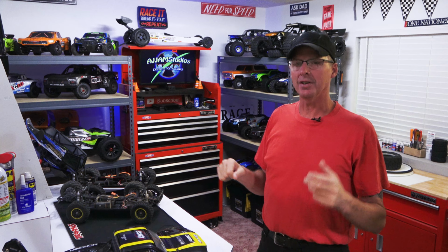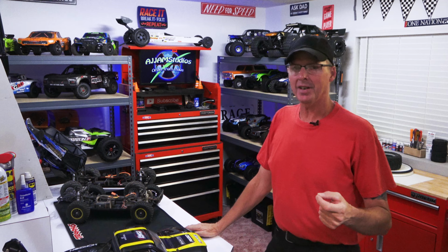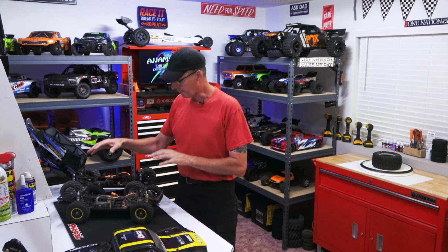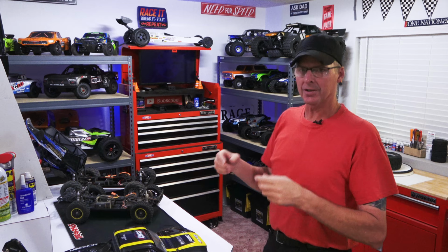This had some really good batteries in it. They were ADC and it worked really good, but that high traction did cause a little heat and it's still running on the stock pinion. So the thing with that is when we were out running in the wide open where this could go full blast, it didn't get nearly as hot because the traction level was lower and it was able to spin the tires and not pull so many amps out of the battery.